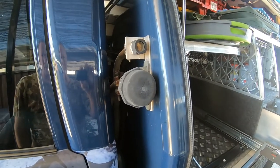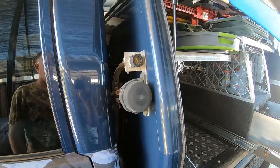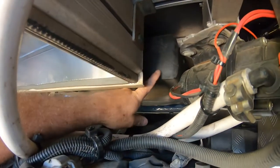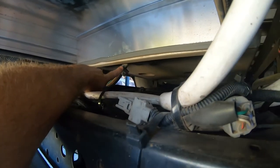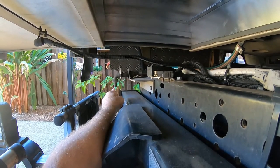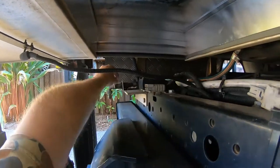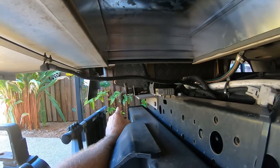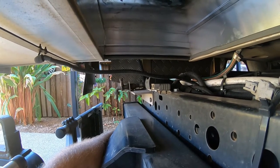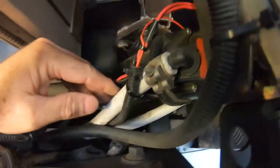Generally I don't use that filler - I use a tap out the back and just plug in the hose, and once I get a little bit of water out the breather I know it's full. At the back of the tank you can just see there's an outlet with a hose coming out. I've put a T-piece in there and one side goes out to a gravity-fed tap - just a normal 12mm plug on/plug off fitting with a simple opening and closing mechanism. Generally I fill up through that if I've got a tap - I just plug it in, open the tap up and fill it until I get water out the breather. The other side of that T-piece comes out through here up to the inlet of my water pump.